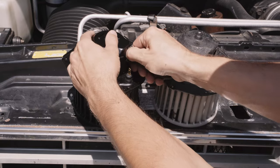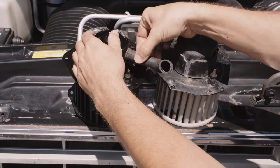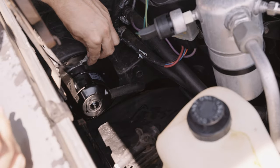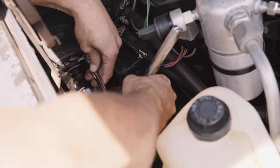If you have heat only, you may not have this right angle hose. If you do, replace the hose and begin putting it all back together. The ground cable screw may take some extra encouragement to get started but will self-tap and thread easily once it catches.